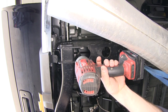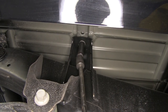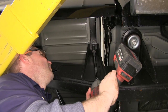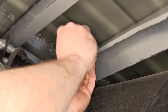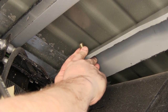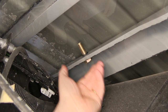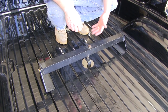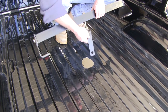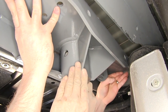Now we can put our four bolts that hold the bed to the frame back in on the passenger side. We'll put our half-inch by inch-and-a-half long bolt into the second hole on the front cross member, and secure it by sliding the rubber O-ring on, making sure it's firmly against the cross member. Then we'll use a support device to hold up the center section of the gooseneck from underneath — it has a bracket that comes down through the gooseneck portion, and we'll put a bolt to hold it in place, allowing us to bolt everything else together.